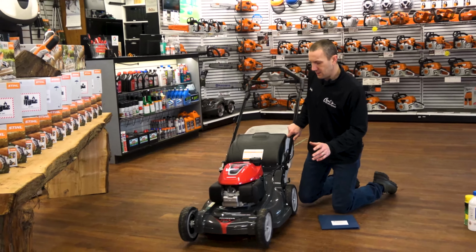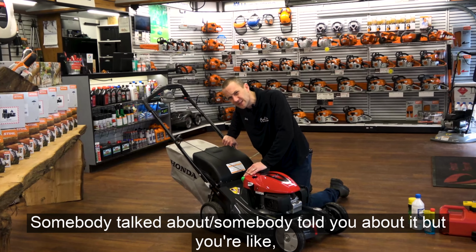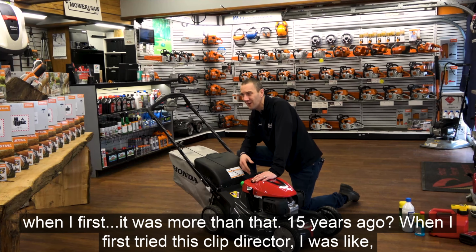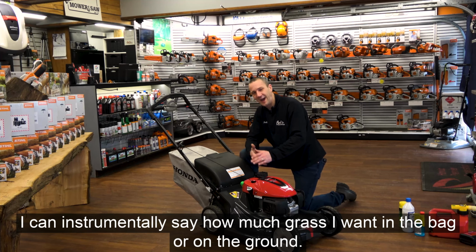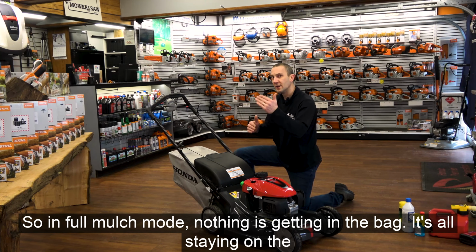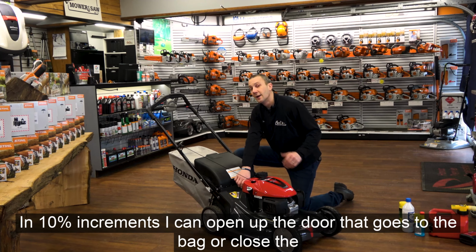You've got the clip director. Maybe you don't understand how to use that. Somebody talked about it, somebody told you about it, and you wonder, is that going to work for me? That's kind of how I was 15 years ago when I first tried this clip director. I was like, what in the world? That's a bogus scam. That ain't going to work. It works. I can incrementally say how much grass I want in the bag or on the ground. So in full mulch mode, nothing's getting into the bag. It's all staying on the ground.